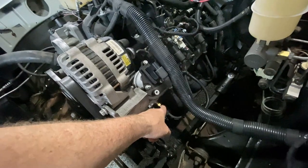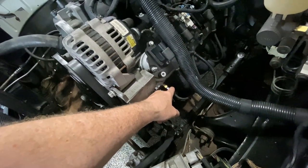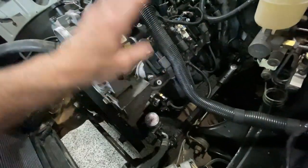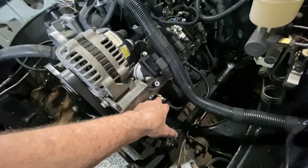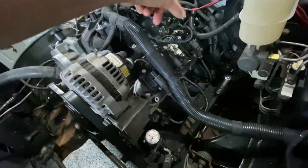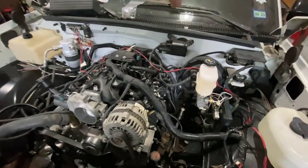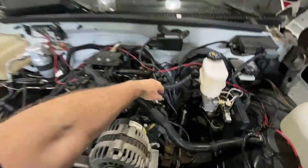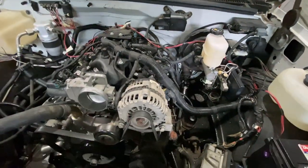Temperature sensor — I'm using a three-wire sensor, for like a 99 Camaro V8. The two wires in your LS harness — the original sensor is a two-wire harness. By connecting those two wires to the appropriate two wires on your pinout for the sensor, it will function because the LS needs to know your temperature. For your gauge to work, that third wire coming off of here needs to tie in to the wire off of your dash. You can trace that pinout off of the back of the dash that I pulled out, and I located the wire in this harness as well. This runs underneath the steering column and enters right over here to the right of your power brake booster. That will make my temperature work properly.